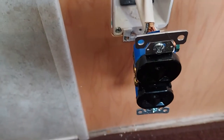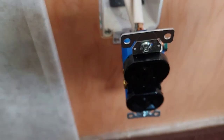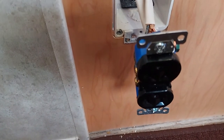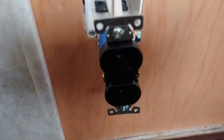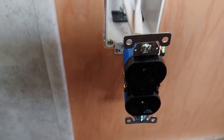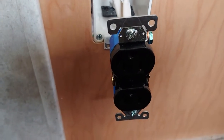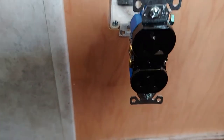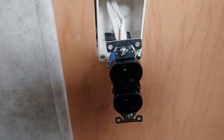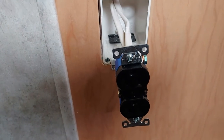The rear outlets — the one on the kitchen countertop next to the gas burner and the one in the bedroom — are wired to another breaker in the power box. All you have to do is the Wago block just like we're doing here and you'll have inverter circuits for all your duplex outlets. I didn't see the need for it right now, but in the future I can just daisy chain off the bottom inverter circuit outlet and go from there.